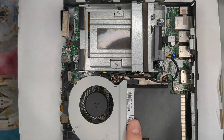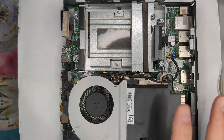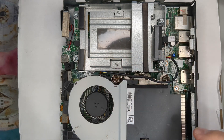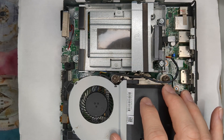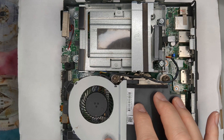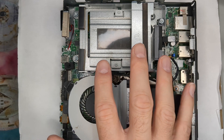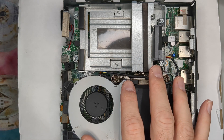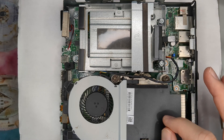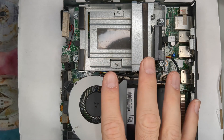This heat sink is for a 35-watt unit — it has aluminum here. If you saw a picture of the inside and this was a copper color, then you would know it was most likely a 65-watt unit. 65-watt units use processors that do not end in a T, while the 35-watt do end in a T. For example, an i5-6500T would be a 35-watt. If it does not have the T, you will definitely need the 90-watt power supply, otherwise it's going to beep at you and complain.